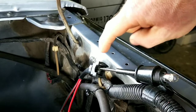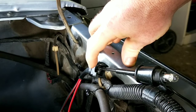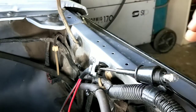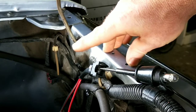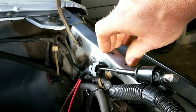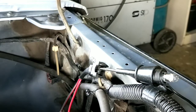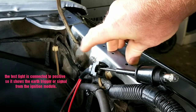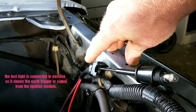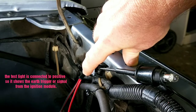This is an easy way to find out which wires you're going to need. It's also a good way to test on an electronic ignition whether it's the module that's failed or the coil itself. As an example, if your ignition module has failed, you won't have a signal on either side of it. One post should be a signal — an open and close — and the other side will be constant power when the key is on and the car is running.